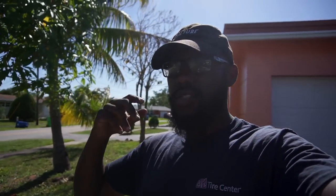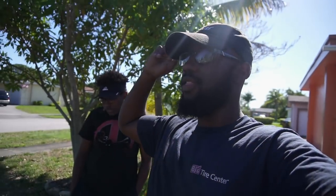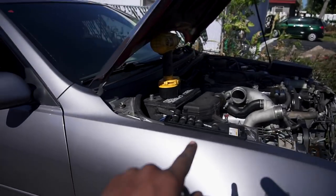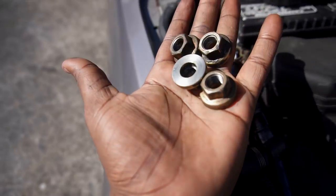We're going to be doing a few things. First, we're going to be bolting up the mounts at the bottom. After that, we're going to install the new throttle body cable. And after that, we're going to hook up the lines to the AC compressor. I also have to figure out the heater core bypass — I messed up and should have bypassed it while it was outside of the car, but it's inside now and I don't have the hoist anymore. It's not too bad, just going to be a little harder to get the hose to maneuver. I got the four bolts for the mounts — it's going to be a 17mm for all four bolts. The bottom mounts are done.